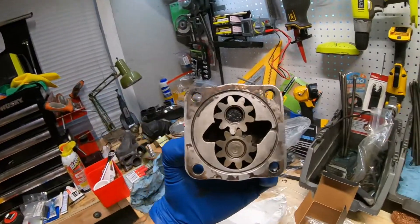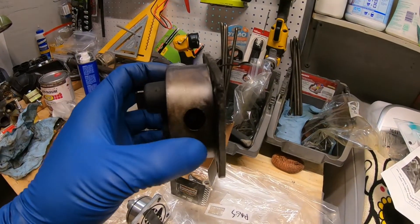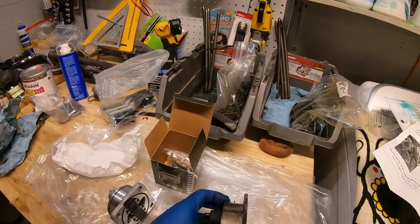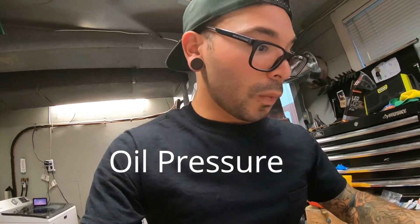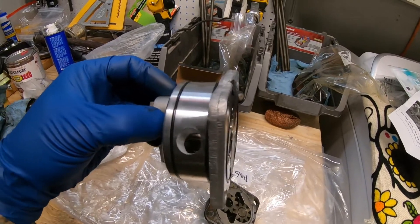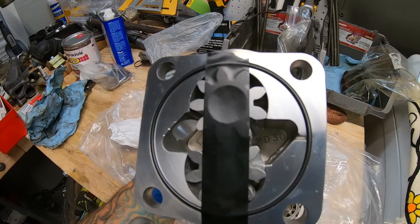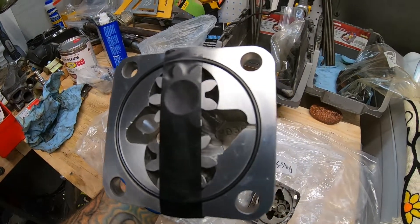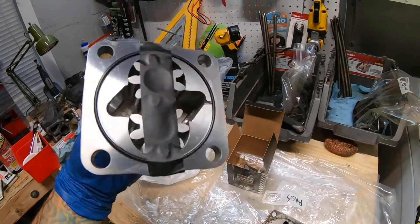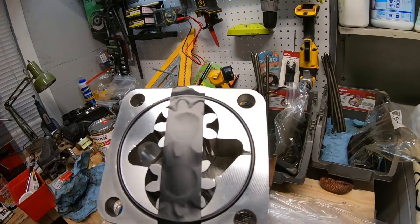In addition to having oil control seals, this factory pump is a 24mm bore — that's this hole right here — which is what allows oil to flow through the block. This one here has been machined out to 30 millimeters; it says right there: HD 30, for heavy duty. Everything is supposed to be clearanced in the front half where the gears ride.